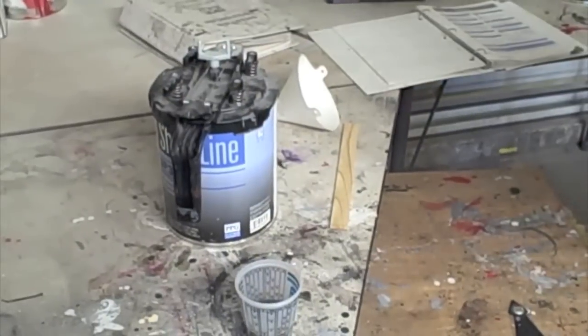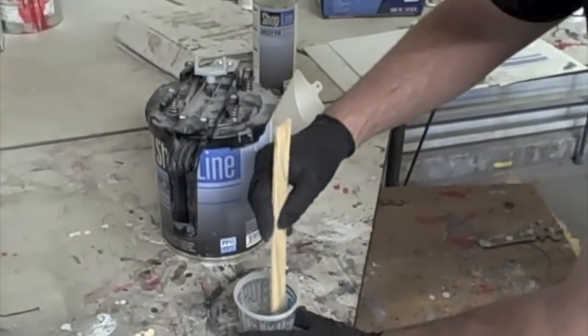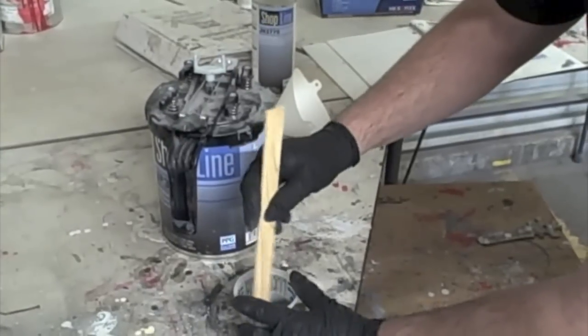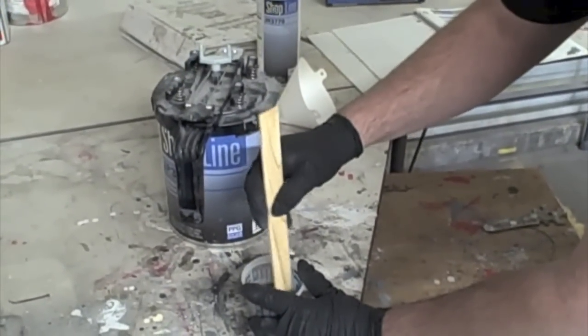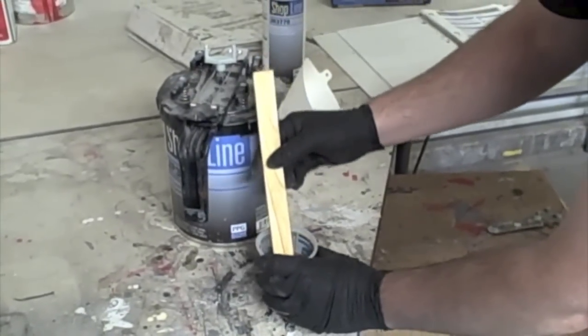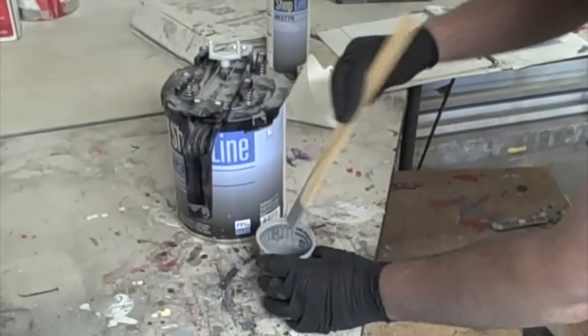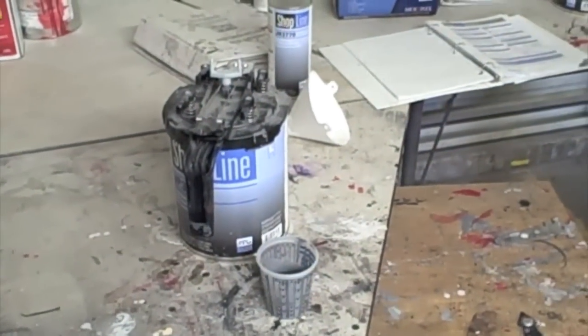You can see it's not a lot — just enough to cover that one spot. We'll go ahead and mix this up, and now we have to let it set for 15 minutes — the 15-minute induction time. Like I said, this is usually just epoxy primers where you'll have to do that step and let it sit. So I'm going to let that set for 15 minutes, put it in a gun, then we'll be ready to spray.